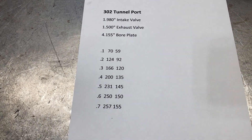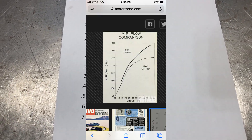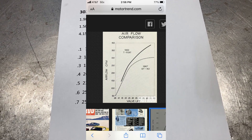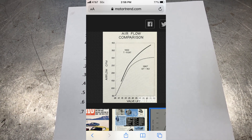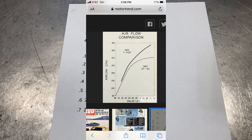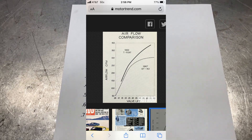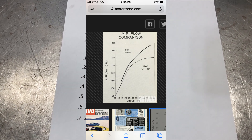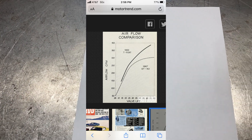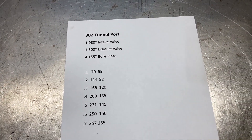If you're wondering what Ford rated these heads at, I'm going to put up this graphic that I found. Here's what Ford says: they're showing their 1967 GT40 head, which I'm assuming is an FE tunnel port head. Those numbers are pretty close to being accurate — 290, 300 CFM. That's pretty close to what we usually see on a stock tunnel port FE head. But I don't know what they were thinking when it comes to these 302 tunnel port heads — they do not flow anywhere near 400 CFM. I don't know if this was a propaganda photo from Ford just to get into the heads of the Chevy guys and the others, but that is nowhere near accurate.